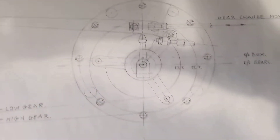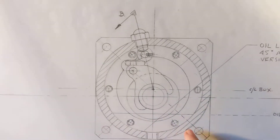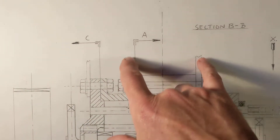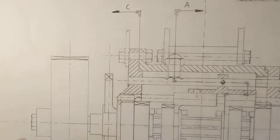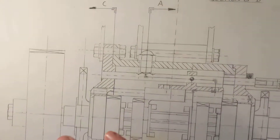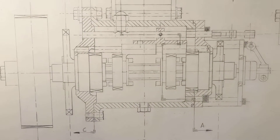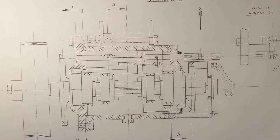This will be the gear change movement - either front and back, or we can rotate it up and down because I quite like to have a hand change. Mounting the box itself - looking end on, these would be the mounting plates. The preferred option is to machine the centre of the box so it mounts at the same distance apart as the back of the engine. The centre line of the engine is also the centre line of the box, the clutch lines up quite nicely, and there's room at the engine end for a dyno start sprocket. It's all coming together quite nicely.